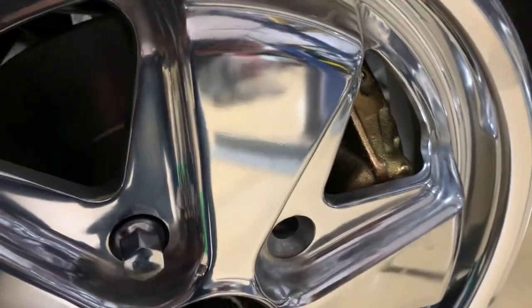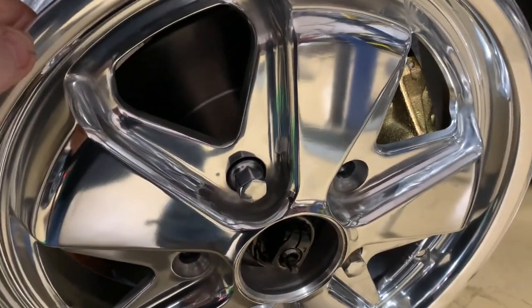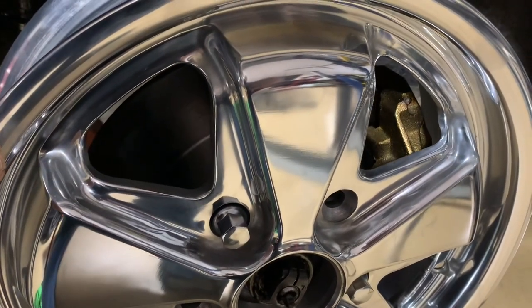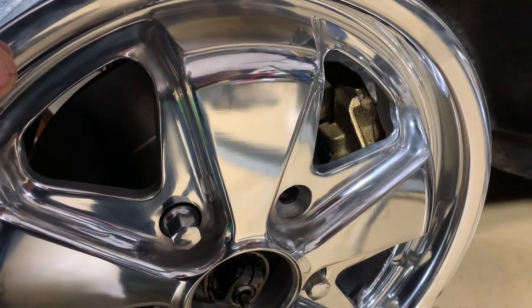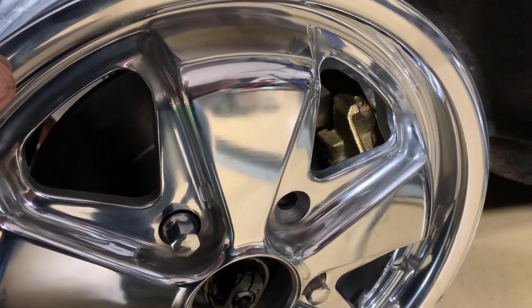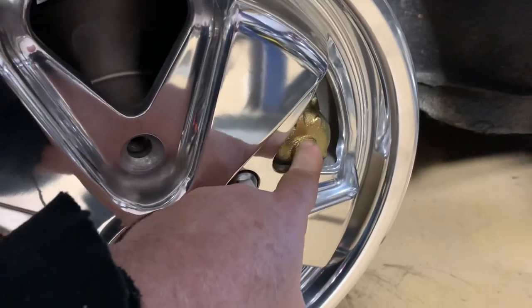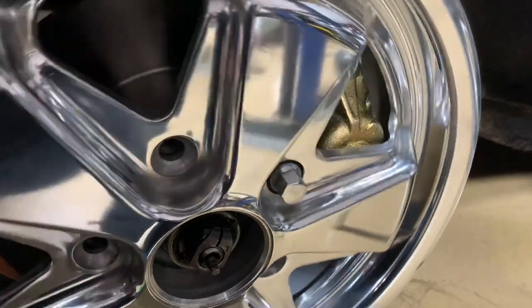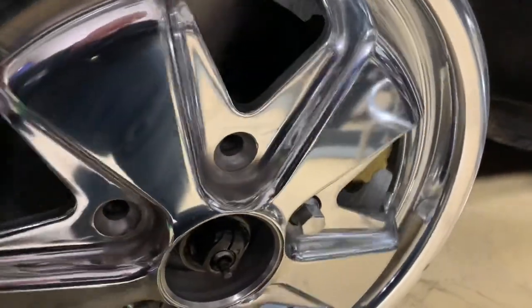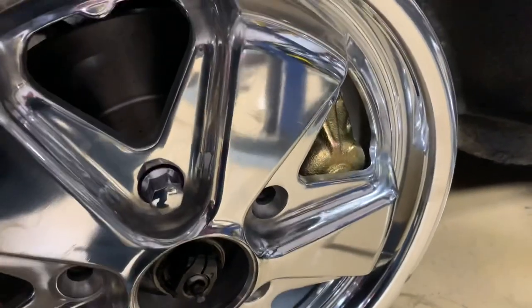These calipers and the brake kit don't come with a shim like Wilwood and some other companies do. But I've installed so many sets of Wilwood brakes that I have some thin washers. You can stack these washers between the caliper bracket and the caliper to adjust the caliper in or out so it's centered on the rotor. Worst case is having to dress down the little plug that's sticking out there. The wheel's not going to flex and it's barely clicking, so let's get that adjusted and move on.